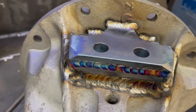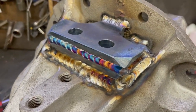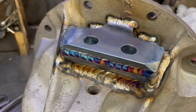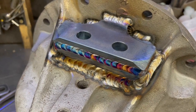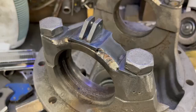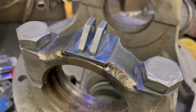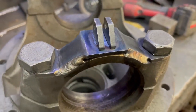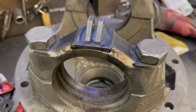Here is the short nose casing welded up. These are an absolute pain — we have to put spacer plates underneath generally, mess about to get it level, then put the top plate on and TIG weld it all up. And because we don't like that silly little pin, we've done the Domex carrier cap conversion on this as well — throw away the standard bolts and fit 12.9 grade.